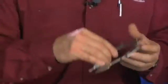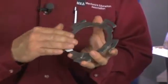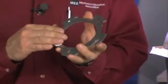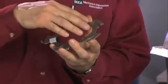Along with that tank O-ring, sometimes what we'll find is that the lock ring gets corroded. And when it's corroded, it sometimes prevents us from making a good seal. And again, that good seal is going to ensure not only don't we have liquid fuel coming out, but we're going to also prevent the check engine light from coming on.